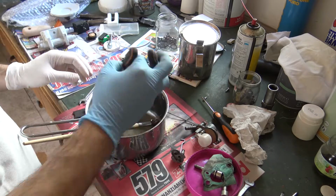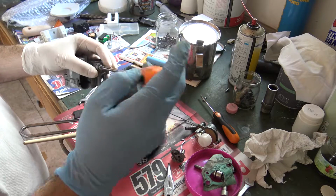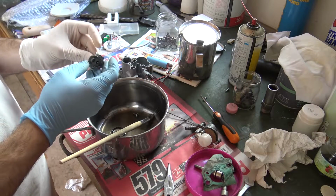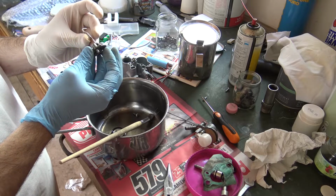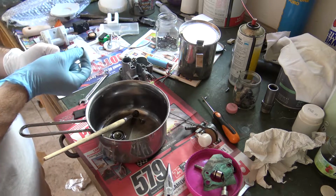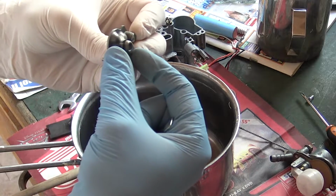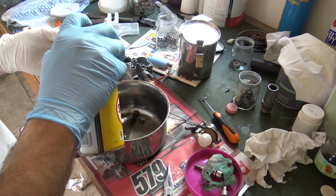Reassemble the choke system. This is without gaskets. Time to open the gasket kit. Now we have to replace all the seals. Start with the hook throttle cable. Just pull and change the seal, which should be included in the kit. So replace the rubber washer. I suggest you replace each gasket one at a time, so you may be sure that it's the same. Using some lubricant will make your job easier.